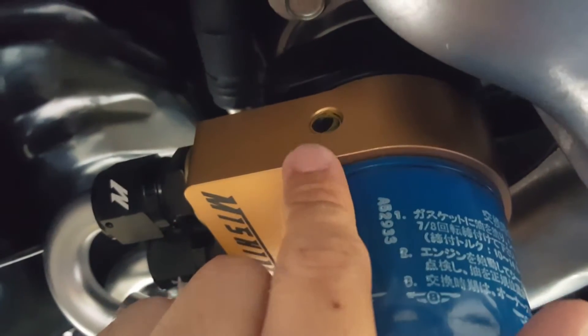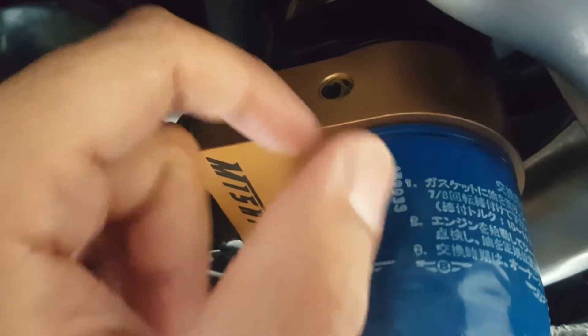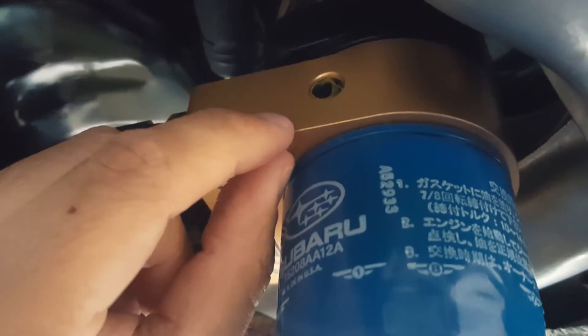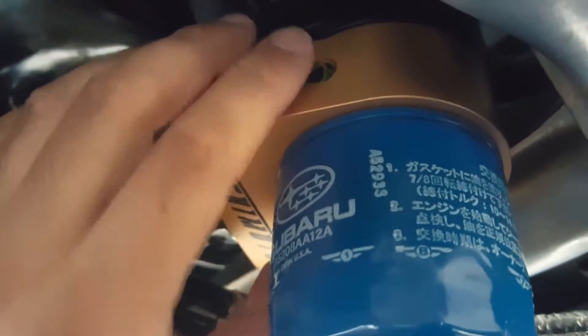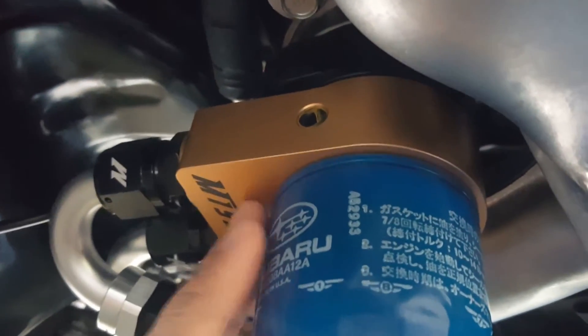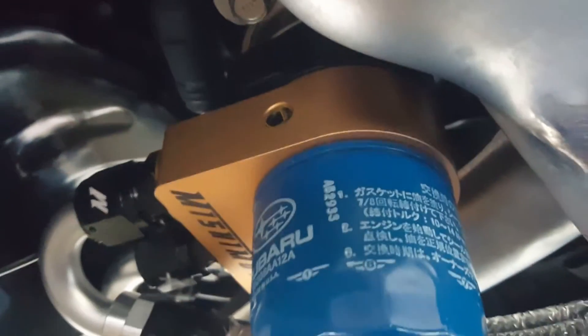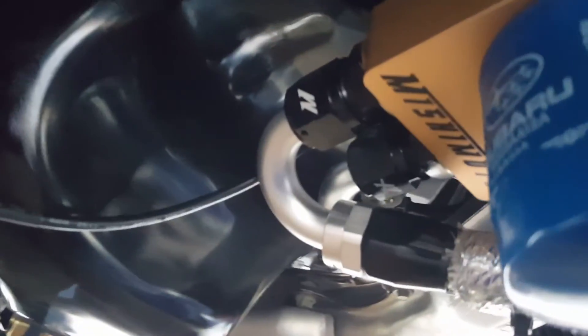This particular port that you see capped off — ideally I would want to put the temperature sensor there, but this cavity, when you take the filter out, isn't thick enough to receive the sensor before it collides with the center ring holding the adapter for this whole assembly. So this port is no good — they shouldn't even bother putting it on. It might work for a pressure sensor, but I'm using another location for that. I'm tapping the block where the factory sensor was, and I'm happy with that location. Less wires under the car. Right now I have a wire coming out here from the engine bay behind the firewall, and I'm just going to zip-tie this.